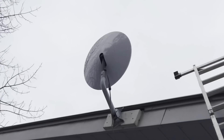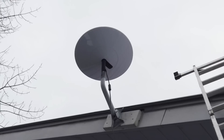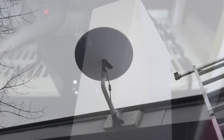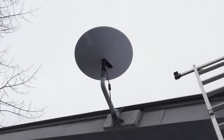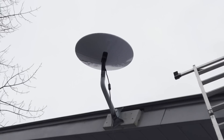My video recording of the next few steps was pretty terrible, so I'll just describe it instead. To check that my Plan A dish location was okay and to test the overall system, I plugged everything in temporarily. It's very simple — just plug the long black cord from the dish into the transformer box, which is also a power-over-Ethernet injector. Then plug the transformer into the wall and wait about a minute. The first thing that happens — which is so cool — is that the dish automatically aims itself in the correct direction. Once it connects to satellites, the white flashing light on the router goes solid. While it's doing that, follow the directions on the Starlink app on your phone to name and set up your Wi-Fi network. It's super easy.